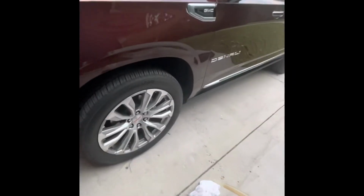and now we're gonna go to the bottom drain plug. I'm gonna take that guy off with a 15mm socket. Location, you're gonna follow me under here. Under the driver's side door, there's your filter, and there is your drain plug. Let's get started.